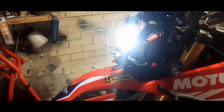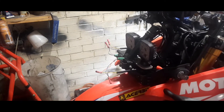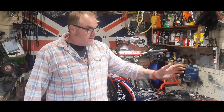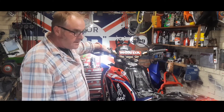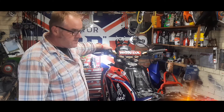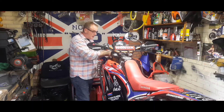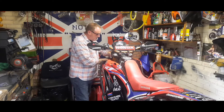Okay, let's put this baby back together and tidy up that wiring. And that is the LED indicators all done. So basically now just got to put this back, get the mudguard back on, just double check everything's working before we start putting all the things back on - and it's working. Yes, lovely. So we'll get this back together. I'm just tidying the wiring loom up now at the front where I've connected the front indicators in, wrapping it with a bit of tape and cable tying them back out of the way, just trying to make them look a bit tidy.